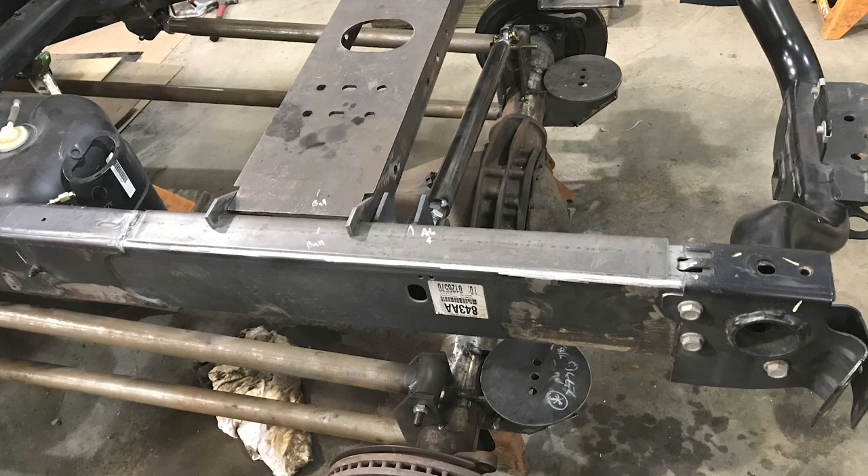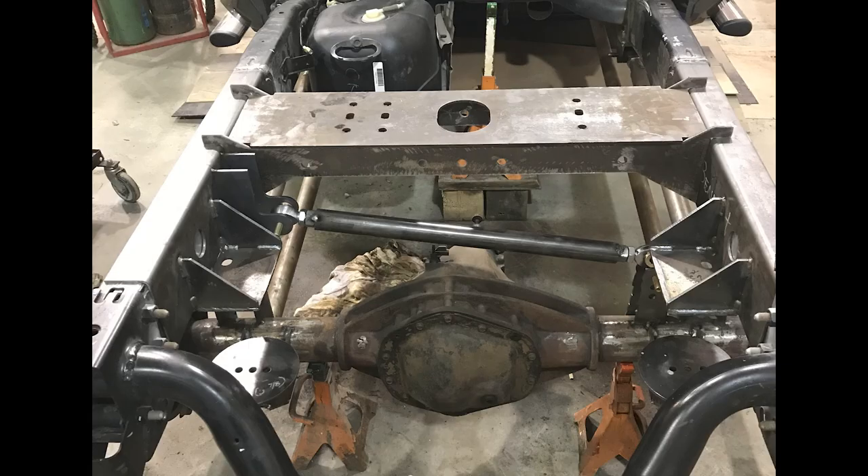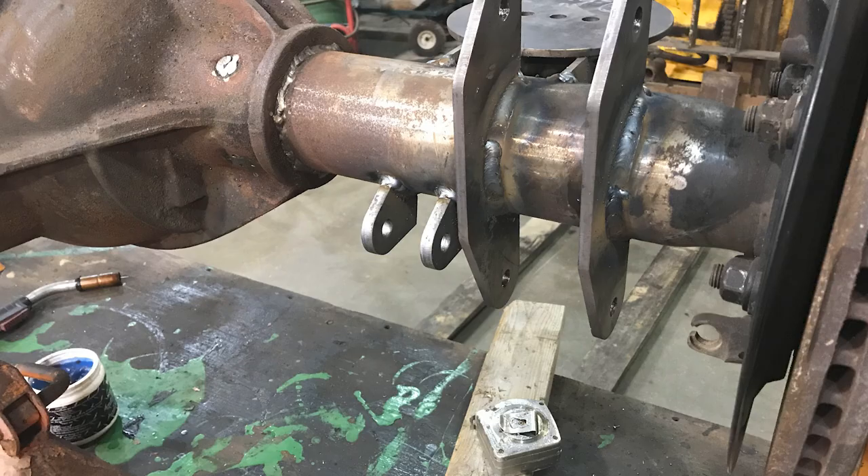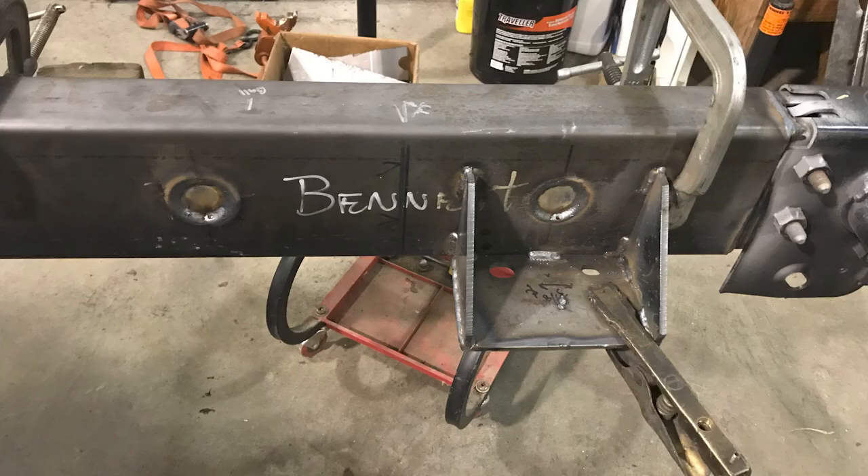We put long studs in it to help hold the dual wheels — a full 20-inch dual wheel. It'll allow around a 13.5-inch tire side-by-side with no spacers. You can see the crossmember being mocked in — a friend of mine cut that out on a CNC table. It'll hold a B&W latch box for a GM truck because they're a little skinnier and I needed the room. You're starting to see some of the plates being welded on the axle — four-link tabs, the airbag plates, all that good stuff — and the upper bag mounts welded onto that sleeved section.